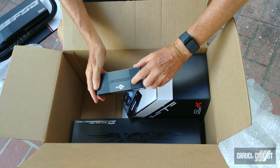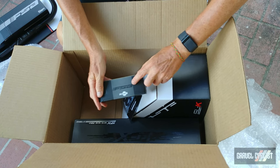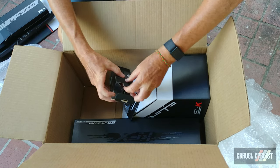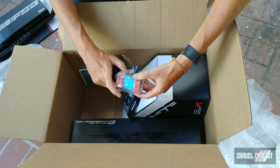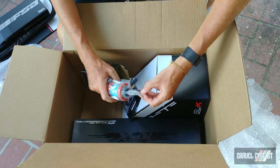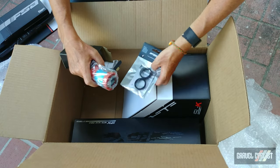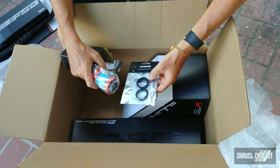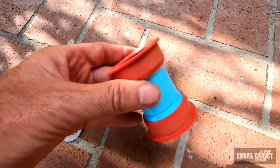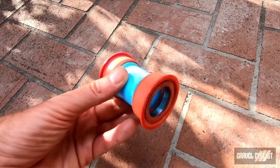Here she is — a very nice, sleek-looking stem with titanium bolts for your lightweight pleasure. Inside the next box is the most abused item on one's bicycle: the humble bottom bracket. In this case, it's a press-fit 30 FSA unit with ceramic bearings. Let's pop it open — what an infectious color scheme, light blue with red. We've also got some grease in there, and to make this compatible with the crankset I'll show momentarily, we have BB 386 EVO adapters. Fingers crossed we don't have any creaking — adapters can creak sometimes, but I've generally had good luck.